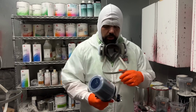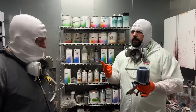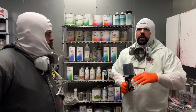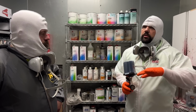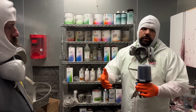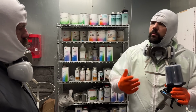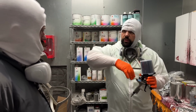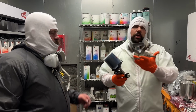So we'll go in here. What we're after on this is a 2-coat. Everything that I have sprayed with Imron covers in 2 coats. On our first coat, the whole point of the sealer is to get everything uniform. It's going to help coverage. I'm going to do the first one for you. We're going to get a nice medium wet coat on. You're going to go through and do every single thing medium wet, and then we're going to come back and put the second coat on. So you won't have any problems. It's going to look good.